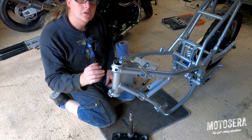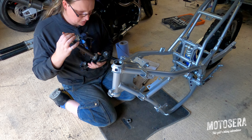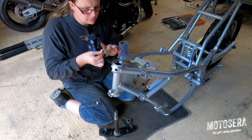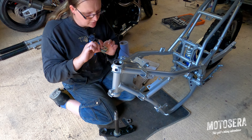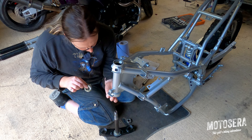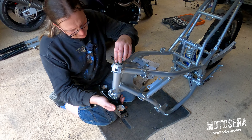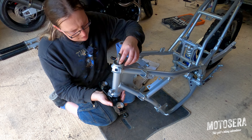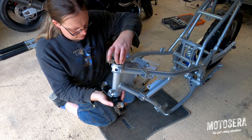So I've got the bike the right way up. The next thing we're going to do is assemble the steering stem into the frame. I've already put new bearings on it, so I'm just going to pack those with grease. You can get tools to pack tapered roller bearings with grease, but you can just force it in there with your fingers if you don't mind getting grease all over your hands. Then I'm going to pop a little bit of grease in where the seals run in the frame. Then we feed the steering stem up from the bottom — bearing in there, grease seal.